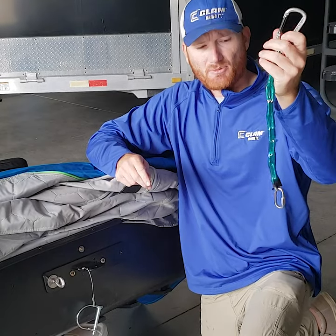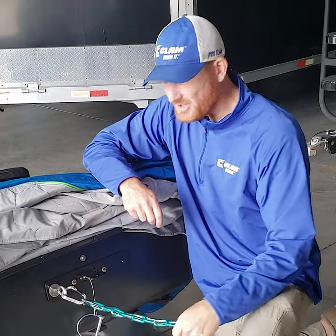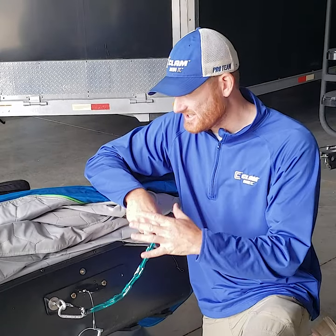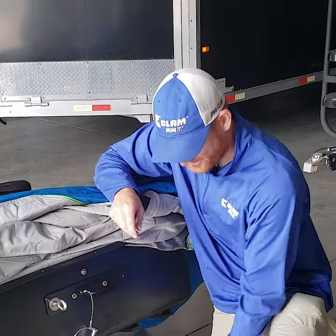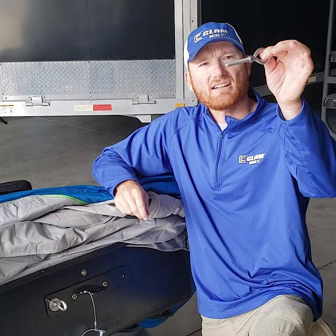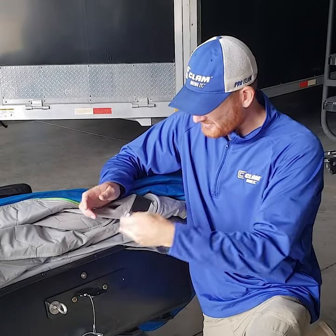Having something like a little section of chain with some clips allows me to clip in there, even just dragging a rope to pull the thing around — just another tie-down point. I use them in my trailer to tie the thing down so it doesn't slide around. Just a nice connection point that otherwise is not going to hurt you. 3/8" bolts is something I'd recommend — any lighter and you can break them. But a little modification makes a big difference.